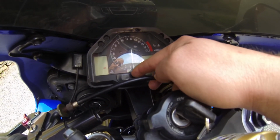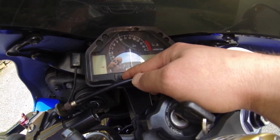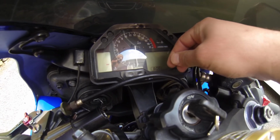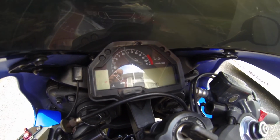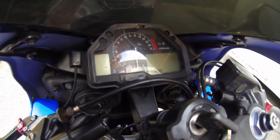One of the two buttons, I think it was the reset button, wouldn't work. So I took it all apart and cleaned the contacts, so now it will work. You can just stick your key in there. I didn't think it was worth actually replacing this cover because it was like $100 and you never really use it. But you can pull that tape off and just push them in with the key.